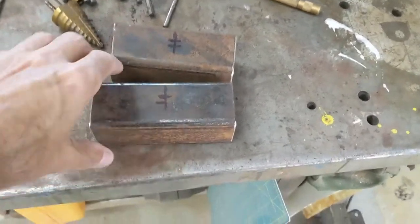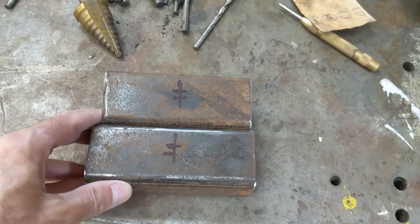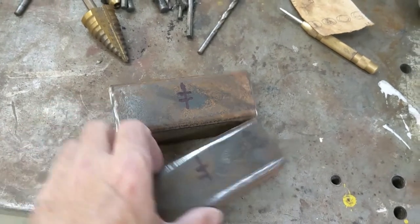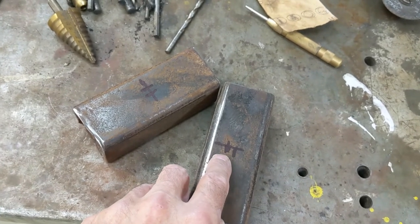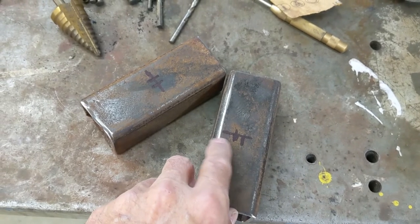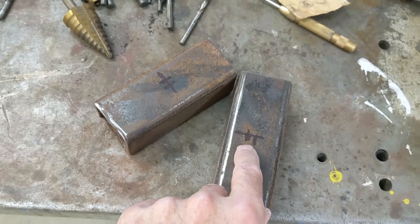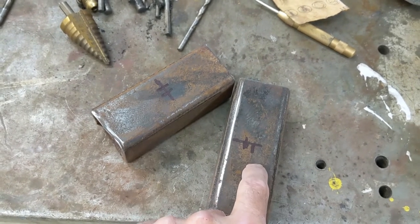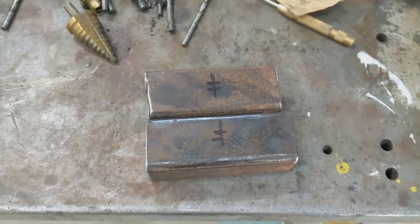Here are the two pieces I'm going to use — they're roughly five inches long, not exact but roughly the same length, which will work fine. I'll be drilling a hole, but I have to be careful — I have three-quarter and one-inch positions marked off. I think the three-quarter mark will be too close to the bottom of the trailer now that I'm putting these up in the box area, so I'm going to go midway, drill the holes, and then weld in my half-inch threaded stock.